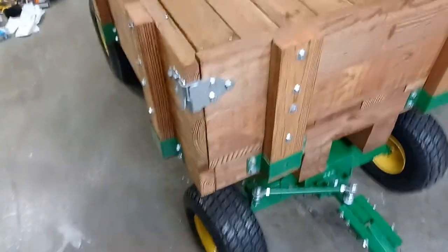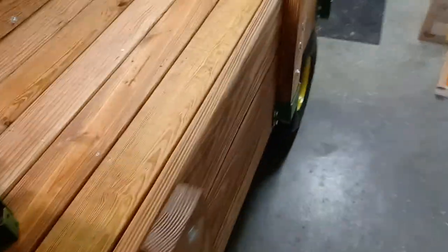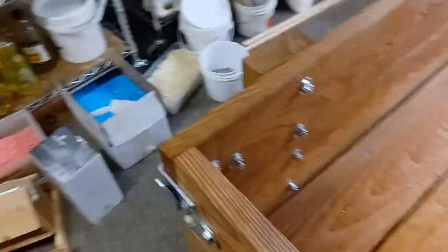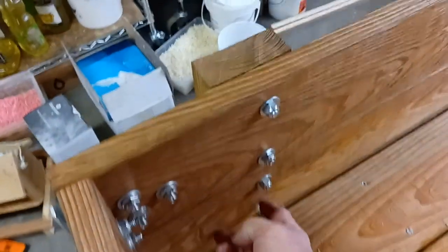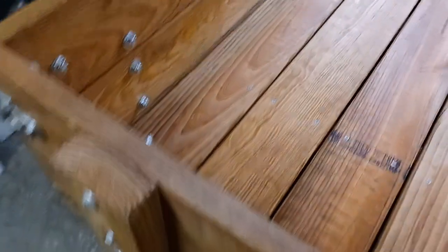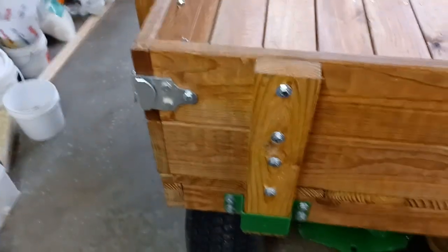Like you and I discussed, it's not going anywhere — it's in there pretty tight. I ordered four corner brackets and put the other two on the tailgate, which worked out really well. This has a five-foot bed — 60 inches. Originally I was going to take a couple pieces of angle iron, put them like this with a slot, and drop the tailgate down into it, but I didn't want to lose any more of the bed. So that's why I put two more pockets on the back end and used those corner brackets instead.